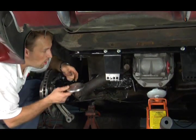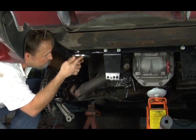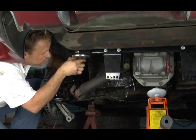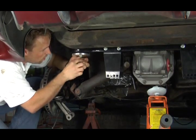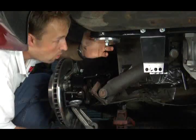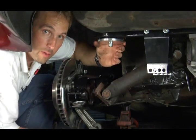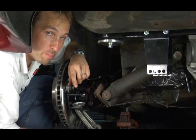The way you top this off is you slide these reinforcement washers in place — the washer, lock washer, and a nut. Once you've got the reinforcement disc in place, you're going to tighten this up to 25 to 30 foot pounds of torque.